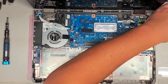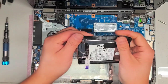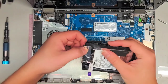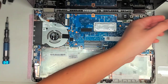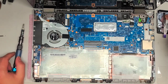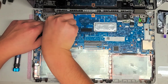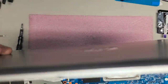I'm back. I removed the hard drive. If you wanted, you can actually change it to an SSD — you can just transfer over this rubber piece. You also have to peel off this foil. There's an adapter under here to get this cable; you'd have to pull that out and put it on the new drive. Now I'm just going to flip up the tab for the screen cable connector. I'm not going to take out everything — I'm just going to be doing the stuff for the screen connector.